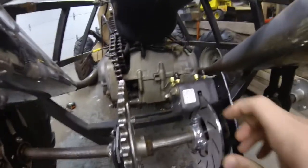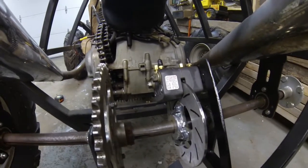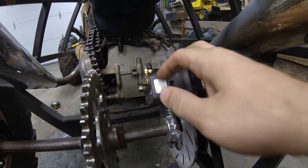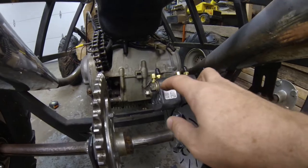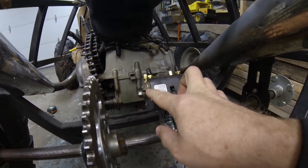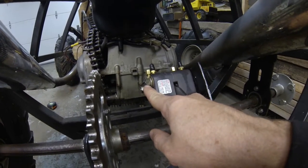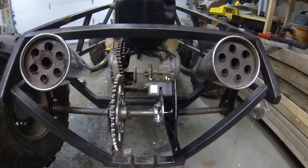And if you remember, it came with castle nuts, which I thought were silly, because there were no holes in the bolt. So the castle nuts pretty much are useless. I happen to have a bin full of 3/8 inch hardware, so I just put a washer and then a locking washer and then a regular nut on it, and that'll be good. And it rolls.